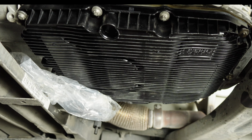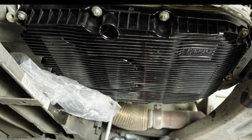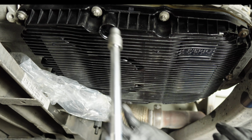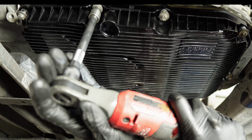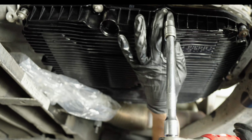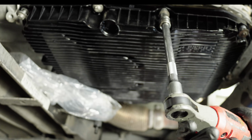I went ahead and I threaded in all my e-torx bolts, and I threaded in my little torx bit bolt on the corner. I'll go ahead and include in the description the torque spec for all these, but I'm not gonna be torquing these to spec. I'm gonna be tightening them to tight enough, and I'm gonna be doing it in a sequence. From the inside out. So I'm starting in the middle.